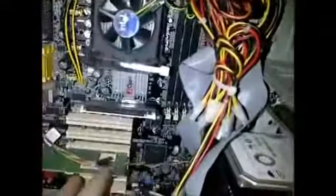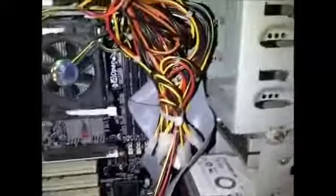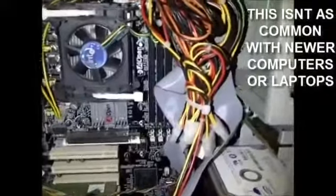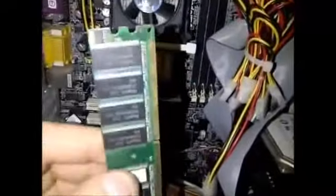Going back to diagnosing your computer — you've pulled out everything. Your power supply is only connected to your motherboard, there are no cards unless you have to have your video card, and there are no drives connected. You can try to power the computer on, but all it's going to do is beep. If it doesn't even beep, odds are not looking good that it's even going to turn on.